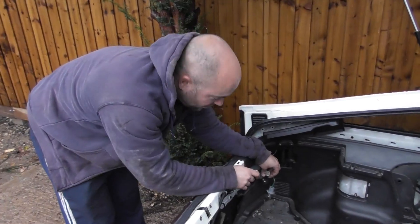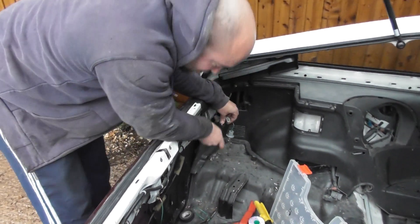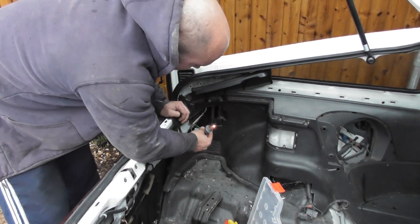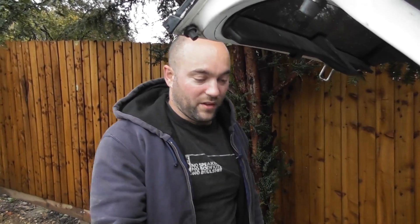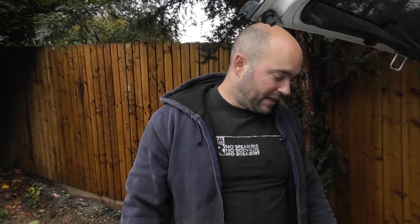It's not perfect yet - it's still a bit flaky. There's still a bit of crap in this indicator and I think the pin is slightly bent as well. So I'll turn it all off again - it's all to do with that pin on the indicator and the little connection harness. So I'm just going to make that mint and put it all back together. After I cleaned the contact I noticed the pin was a little bit bent round as well, so all I've done is straighten it out with some needle nose pliers, and now it works. Even if I pull the connector one way or the other, it's working. That's basically your fix - just think of it logically. It was just basic corrosion on the contact - it's going to happen in these old cars anyway. Indicator works - I think we're ready for an MOT now. I'm going to book it in, fingers crossed. I've fixed everything on the failed MOT list, so I can't really see why it would fail now.